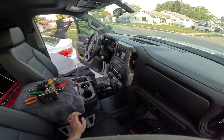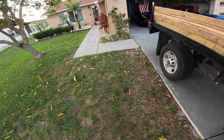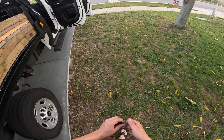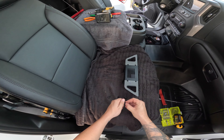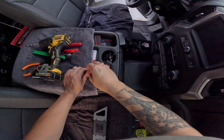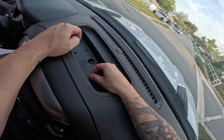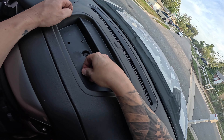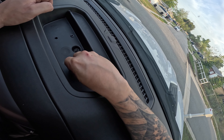Alright, so back to this — it's going to be super simple, guys. All you got to do is drill those four holes, grab your plate and keep it right here. The only things we need are these well nuts. So we drill our four holes, put the screws down, and just push your well nuts in, just like that. Don't worry about drilling in here — there's nothing under here. It's literally just a little plastic bar right there and it is hollow for probably eight inches on each side, and then your AC vent goes right here, so there's really nothing you're going to hit.